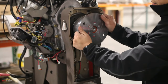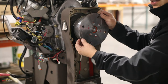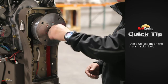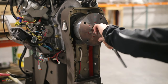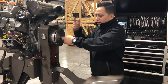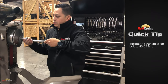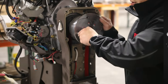Push it in — the planetary gear should just go in smooth. You saw me working it out while spinning it; don't tap it, don't hit it with anything, just like that. Put a little blue Loctite on your bolt. I'm going to show you guys: the same way I took it out, that same way you're going to torque it. The torque spec for this is 55 foot pounds.